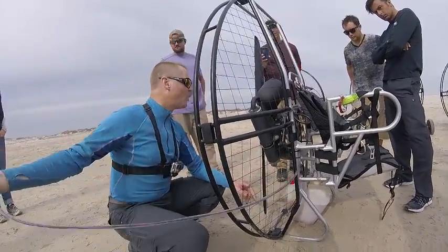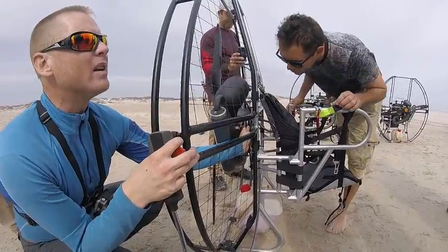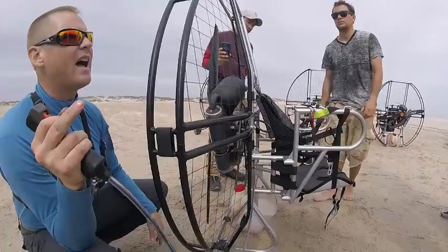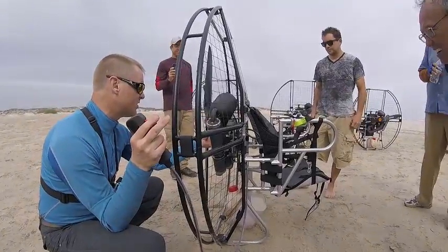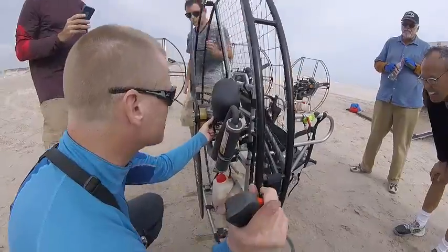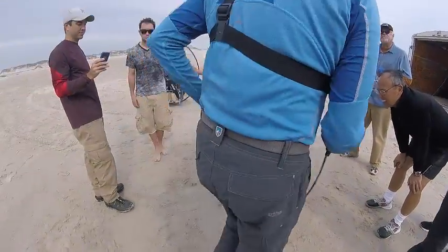But anyway, if you pull the cable really hard, you could possibly unseat your throttle cable. And if it pops out, then it could be locking your throttle at a higher RPM. And you go to start it, that would be bad. If you notice any issues, you can hold your throttle rocker arm and pull the trigger, and that can reseat the system. But you want to pay attention to it and make sure that it is nice and tight.